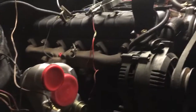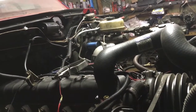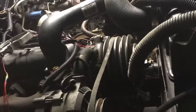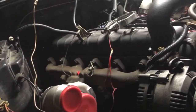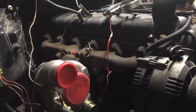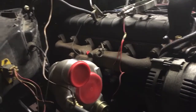I have a nipple here for the heater hose and some alternator wiring ran. I still need to put the power steering pump down there on this side and get the hoses for the power steering — I need to get two made and the rest extended. We do have the hydro boost set up there, but with the three-inch body lift, the hydro boost line doesn't reach anymore, so that one needs extended. There will be a hose coming from the box over top of the engine. I'm toying around using those brackets to hold the heater hoses or power steering lines — not 100% yet, but we'll get that worked out.